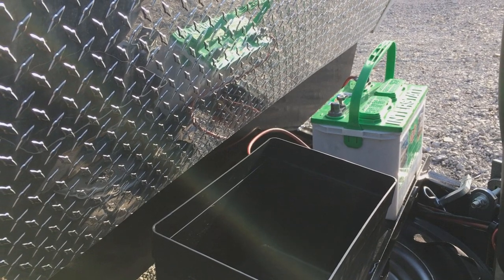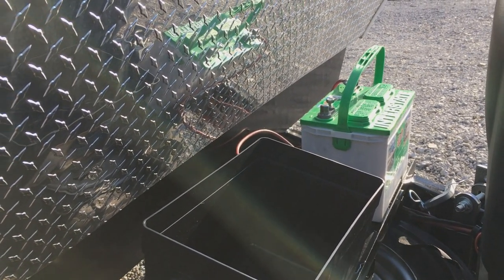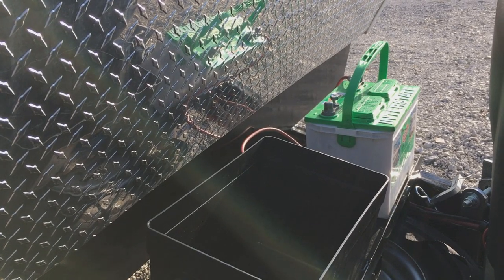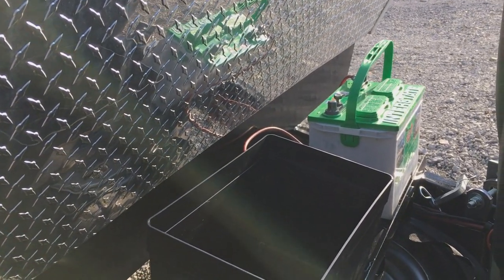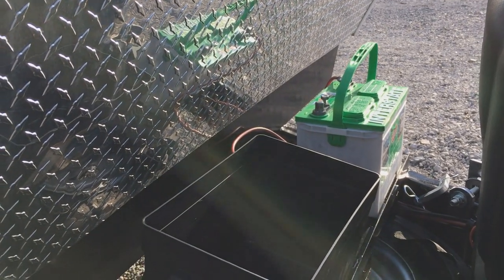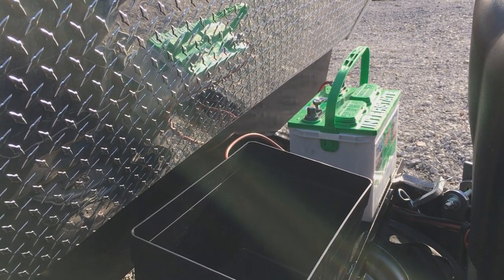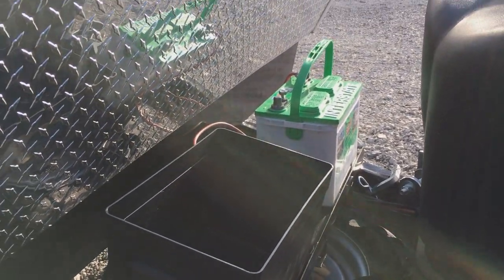In this particular camper, there are quite a few USB ports on the wall outlets, and I noticed after we brought it home that all of them had little LED lights in them to show they had power. Stuff like that just draws power down. In our case, we're not camping every weekend, so when the camper's sitting with the battery hooked up and those things running constantly, it's going to create enough draw to eventually start killing batteries.